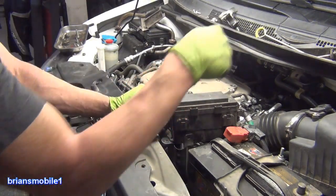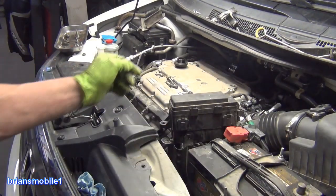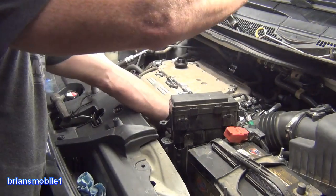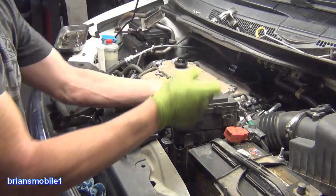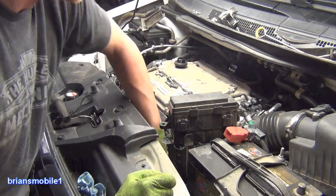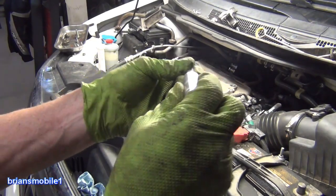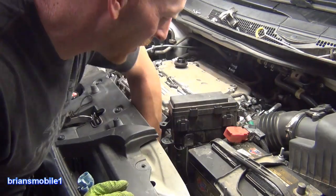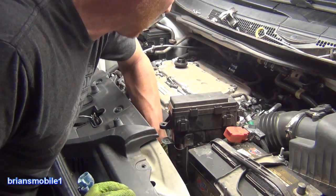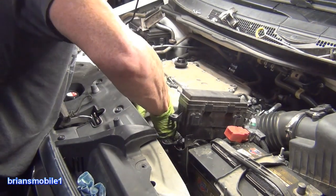Pull the starter out. There's a 12 millimeter nut for the connection — disconnect the negative battery terminal always, this guy right here. Then get a 12 millimeter and two long 8 inch or 12 inch extensions, unzip that, squeeze and buckle the plug for the signal wire. Then there are two bolts — they look so little when you're looking at them through a mirror, but they're 14 millimeter. Then wiggle your starter out, work it toward the battery so you can get the nose to face up. Once you got the nose facing up, you can birth it up and out.